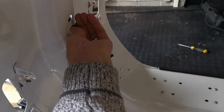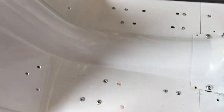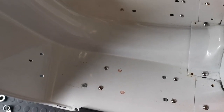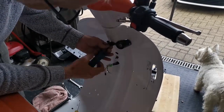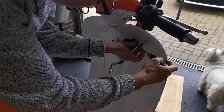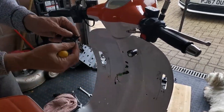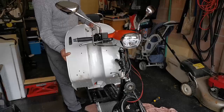Now I'm going to remove this nut here which I've loosened. I'll take that off, and I think what we need are these four allen screws either side — hopefully that will release the leg shields themselves. I'm going to take the cover off the lock with an allen screw there. Now there's what looks like a self-tapper here — I'll take that out, and that cover's away. Easing the shield down and lifting it forward, edging the bottom out, the whole thing comes away.